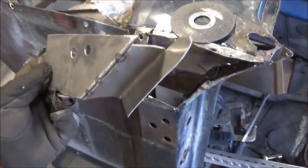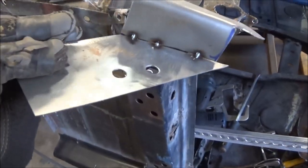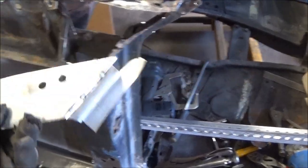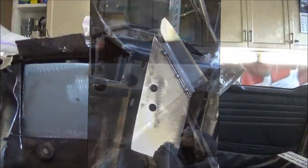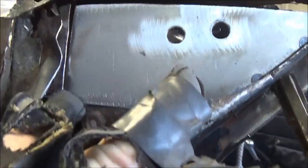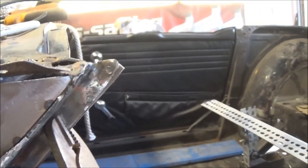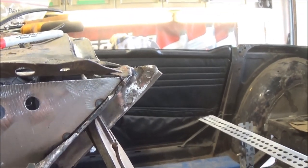Here's where we're at on the second part of that patch — we've just got that now tacked to the front flange piece that we made, and I'm pretty happy so far. I'm going to try to fit it back in there and see how well it aligns with the bottom and sides — it should be good because I tacked it in place. Looking pretty good; it's maybe a tiny bit wide on the left-hand flange, but otherwise pretty good. We'll clean up these flanges on the inside, finish weld it, grind it down, and stick it back in.